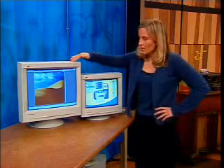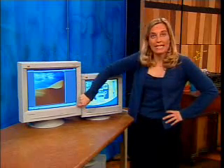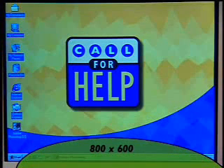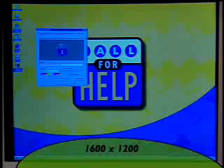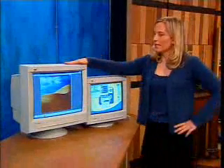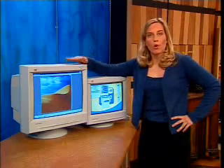Resolution is the number of pixels in the horizontal and vertical directions. Probably on a 19-inch monitor you might have 1024 across by 768 down. You'll see numbers like 800 by 600 or 1600 by 1200 — those are some of the higher resolutions. Let me show you how this manifests in the way you actually use your computer. This is a desktop at 800 by 600 — look how big the icons are on the left, and you can see you've got a smaller area to work with. Now, look at a higher-resolution photo — look how tiny the icons and font are, but look at all the room you have. So if you're getting a 19-inch, you want options of at least 1280 by 1024 or 1600 by 1200, because at times you may really want that high resolution to work with big items.